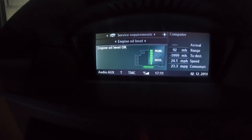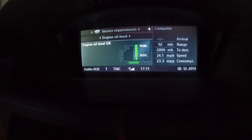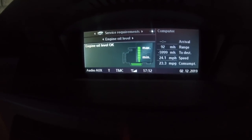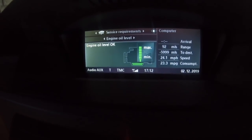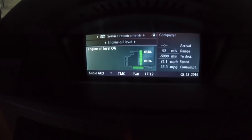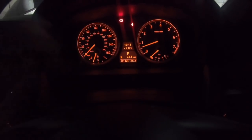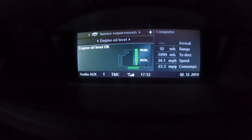As you can see, it's showing the full oil level which is at the max — absolutely correct. It's not over and it's not below, it's the full reading. We're letting it go up to temperature so the oil can work itself around the engine. That's how you check the oil in your iDrive to confirm your level is correct. If you have the M54 engine you'll also have the dipstick alongside the oil level sensor. If you have an E90 without iDrive, you'll have it on a stalk — go through the BC button and the oil level will load up on the screen showing minimum or maximum.